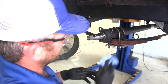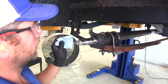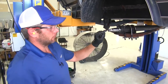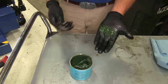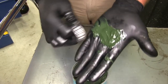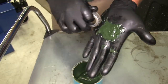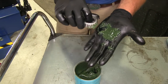We're going to get our spindle cleared off here. Since we're adding brakes, if you're purely doing an axle replacement, at this point you're just going to reverse the process used in disassembling the old axle. The only real difference is that instead of a cotter pin at the end, we're going to have that keeper that just slides over. Now we're going to take you through the process of how to pack your bearings. There's a wide gap here — we're going to force grease through, capture it, and then push. There's no clean way to do this; you can use a bearing packer, but this is a maintenance task you'll want to do periodically to change out the grease in your hubs.